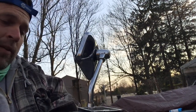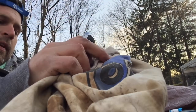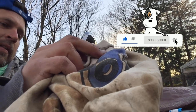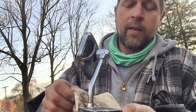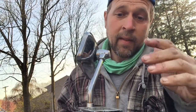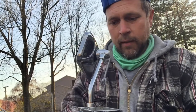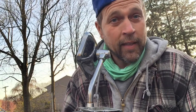One, two. Oh, she's just popping out at me. Keep forgetting to put that over there. Three, four, five, six, seven. So she is pressurized. I have no doubt that we are good to go. I'm gonna top this off and put the lid back on, make sure everything's clean, and wipe everything down once the lid's on with some soapy water, and the clutch will be bled and working, so we can take her for a spin.